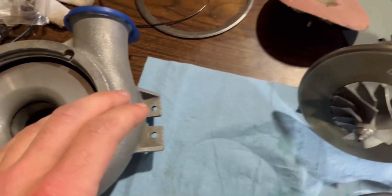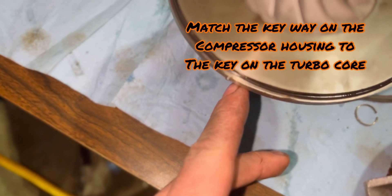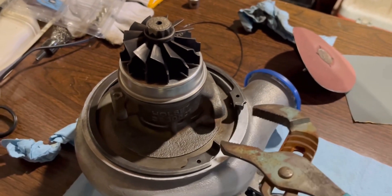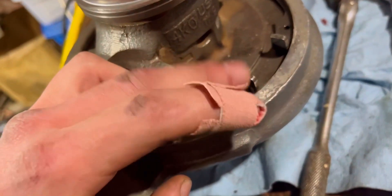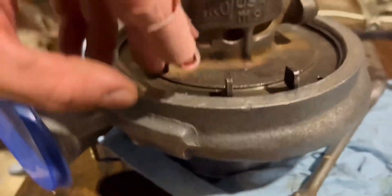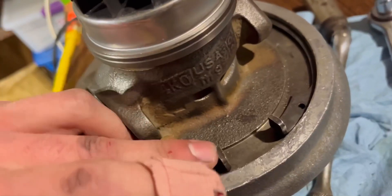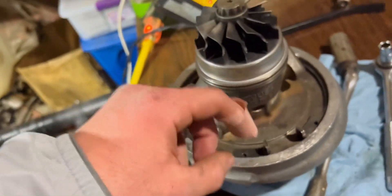If you don't have a groove here that looks like it fits an O-ring, then don't use this O-ring, because then it's not going to seat into the compressor housing properly and you'll have a boost leak or problems down the line. It goes on the compressor housing — right here at the bottom is a keyway that aligns with this little keyway right here. To put this snap ring on, you'll definitely need some adjustables or channel locks. A pro tip: if the tabs are bent inward a little bit, you can put them in a vice and hammer them back to a 90-degree angle so they go on easier.